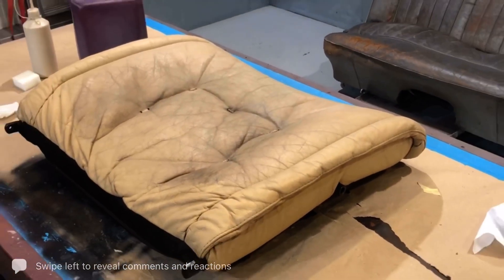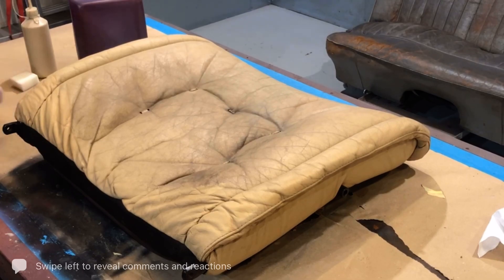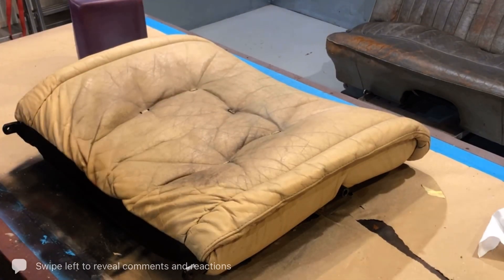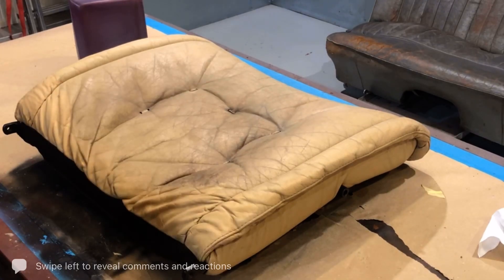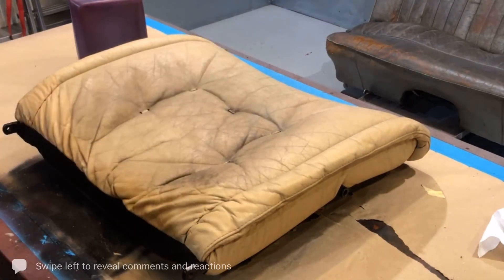So let's do a tiny bit of colouring. Applying colour is relatively easy for those that have never done it. In a tannery, they would put a base coat down, then a pigmented coat, and then a very clear coat of lacquer. Clear coats of lacquer on automotive leather are microscopically thin — probably 0.5 micron. 150 micron is the maximum you're going to get between primer, paint, and lacquer, because it's got to be 0.15 mil thickness on the surface.